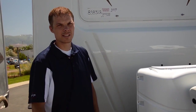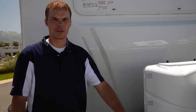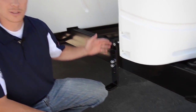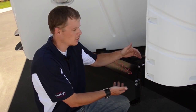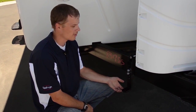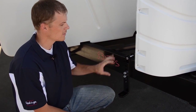Today we're at Ray City RV in Roy City, Utah. We're standing in front of the Rockwood series, the Signature Ultralight. With this particular trailer, it has an inverted coupler. With an inverted coupler, you want to do things a little bit differently when setting up the Equalizer bracket system. Standard Equalizer bracket systems have the two bolts up higher on the A-frame. With an inverted coupler, what you want to do is flip the bracket upside down, putting the double-studded bolts lower to the bottom of the A-frame. This drops the L-bracket lower underneath the A-frame of the trailer, providing parallel arms for your Equalizer when you're using a B-style coupler.